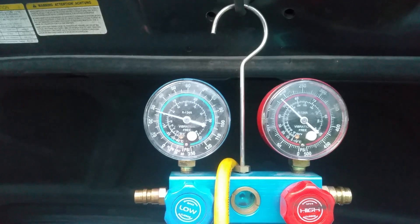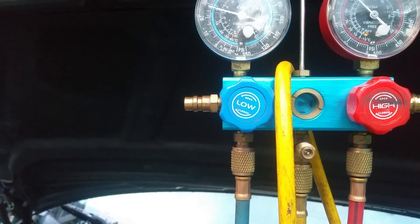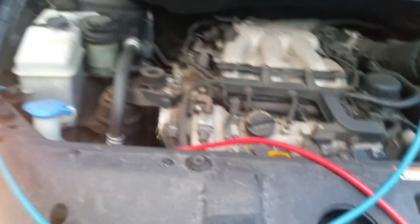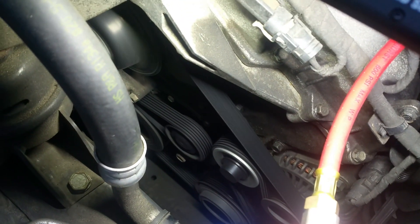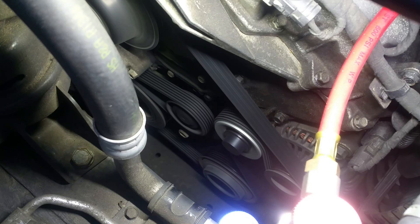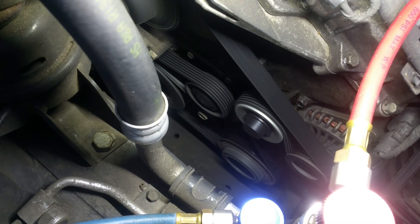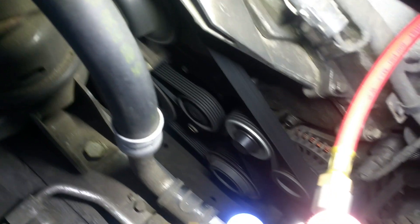The pressure's still going down on the other side. It might be slightly low. It is the original compressor. For now, it is working. Is this a fix? I don't know. But if it does blow again, the only thing on that fuse is the compressor.